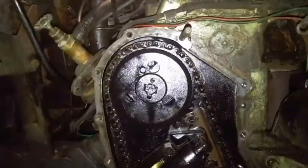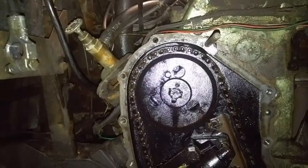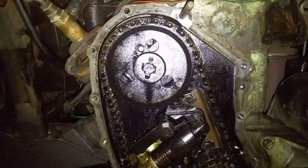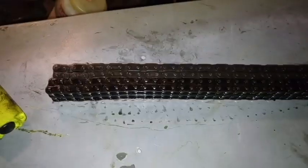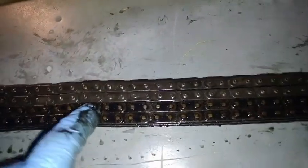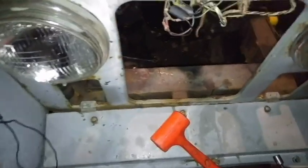I'm going to pull the chain off the other engine since I've got to take this chain off anyway to re-time it, so I might as well try it. These are the two timing chains — my current engine's chain and the one off the spare engine. Interestingly, the spare chain has dimples and says Reynolds England. I test fitted the newer chain and it was still out of whack far enough, so I'm just going to re-time my original chain. Next big shipment of parts, I'll order a brand new chain and slap that in there eventually.